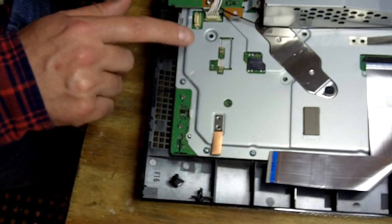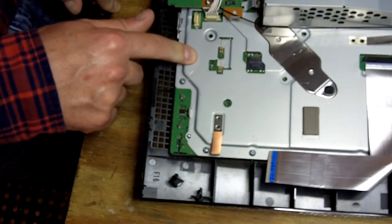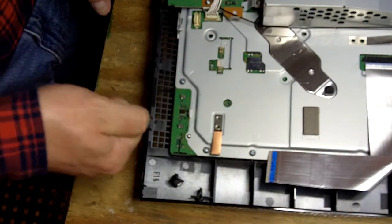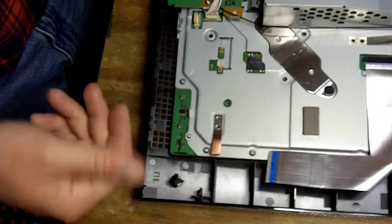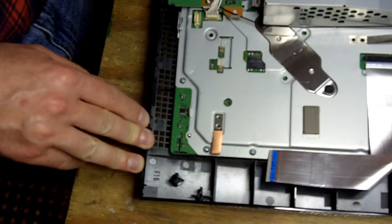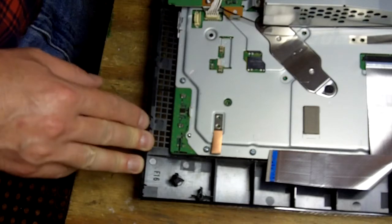You should just have to very lightly touch that button to make the machine either turn on or eject the disk. So if you find you have to mash those down, take the cover off, check those springs — that's a fairly common cause of this problem.